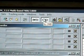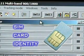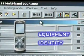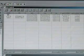There are two filtering possibilities: by IMSI, which is the SIM card identity, and by IMEI, which is the equipment identity. At this moment, all other subscribers start re-registering in another base station, and the system will be free to record and serve only the targets.